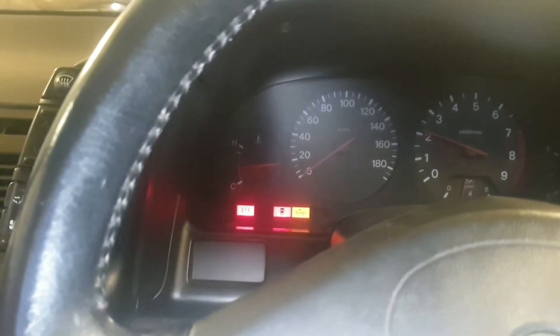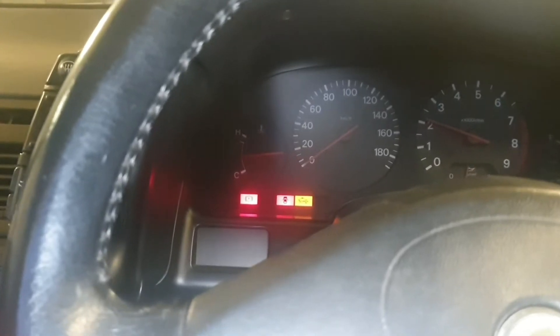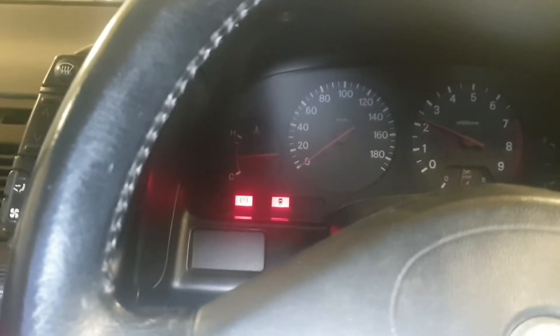That shows it's really, really slow to react and it'll be using far too much fuel. The problem was that this car has a misfire at about two and a half thousand revs, and I fully believe it's down to the lambda sensor.